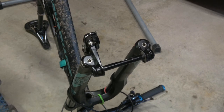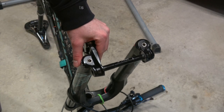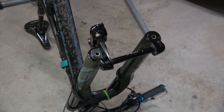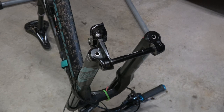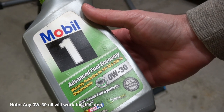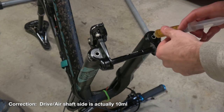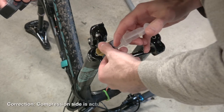We've flipped the bike upside down. Now we're going to add our lubrication. Before you add the lube, you need to make sure that your lowers are actually slightly above the bottom-out point so that the fluid can actually be injected into the lowers. Now we can't see the bolt hole anymore — we're good. Five milliliters of Zero W30 to the drive side, and 15 milliliters to the non-drive side. We have some Mobil Zero W30 oil and an injector with measurements. Drive side is five — just right in. Five on that side, and 15 on the other.